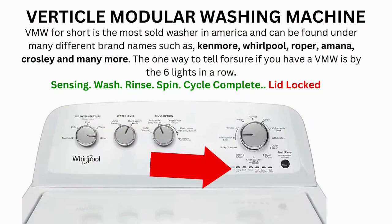Now try your washer to see if that solved your issues; if not, continue to the error code video. If after 20 tries or more your arm feels like it's going to fall off from trying so much, then odds are you have a bad control board. If your washer starts the recalibration but doesn't finish it, you need to pull the error codes and find out why.